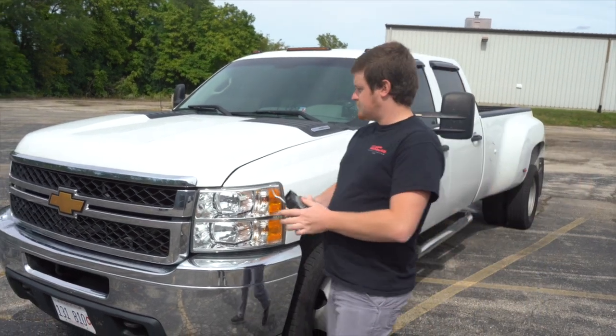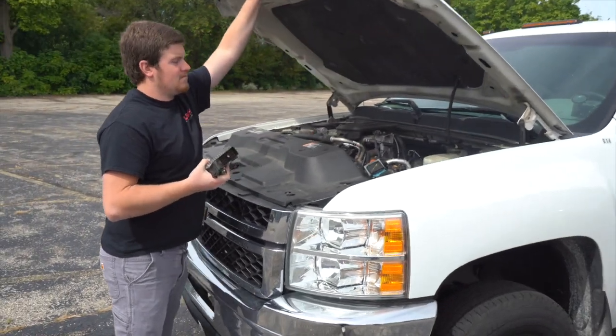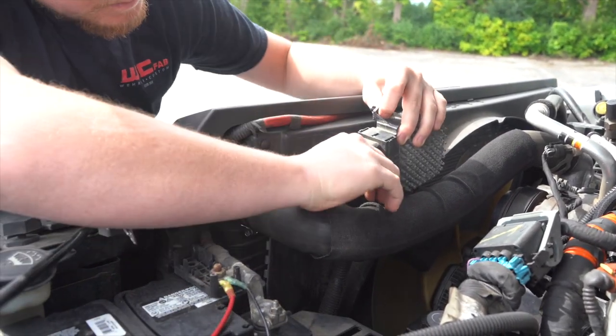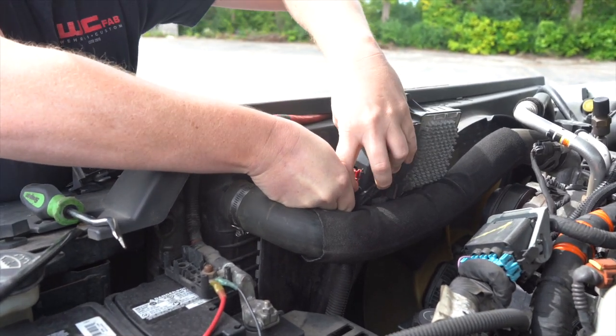This module is the brain that runs your transmission. Without it working properly, you'll notice such symptoms as a hard clunking when you shift into gear, a loss or change in the prindle display, and check engine lights corresponding to the P0700 range of codes.